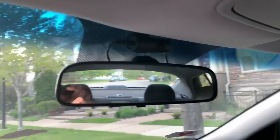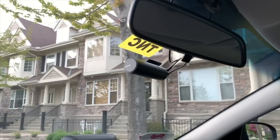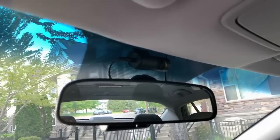The install is pretty straightforward. Both the front and internal view cameras for both models attach to the windshield via an adhesive. You then route the power cable around your windshield and door. The rear view camera — which for rideshare drivers will be your internal view camera — plugs into the front view camera via a long power cord. What I did was just wind the cord around the stem of my rear view mirror. Overall, pretty simple install, with the only exception being the routing of that power cord. The install took me about 15 minutes.